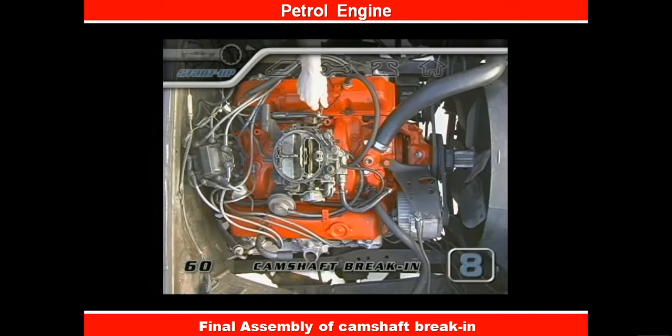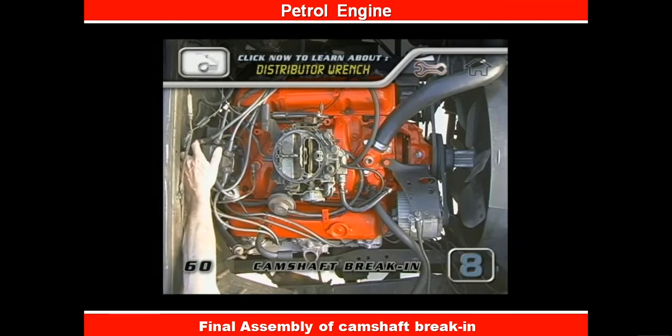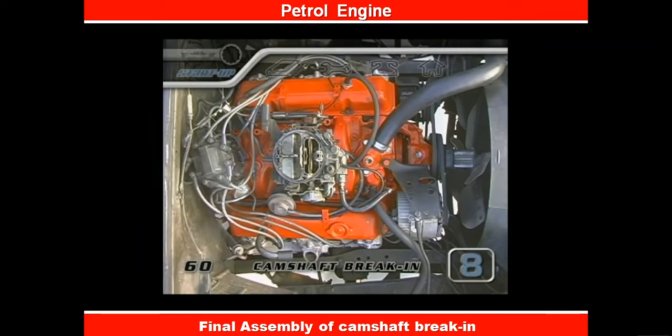Have someone crank the engine for you, but keep your face out of the way because that might happen if your timing is a bit retarded. If the motor did just sputter, loosen the hold-down clamp for the distributor and advance it a little at a time until you get the motor to fire up. If it still won't start, you should go back and check your fuel and electrical supplies. When everything's correct and your advance is set right, the motor should fire right up.